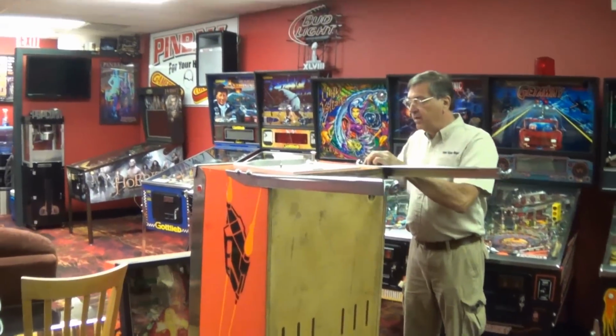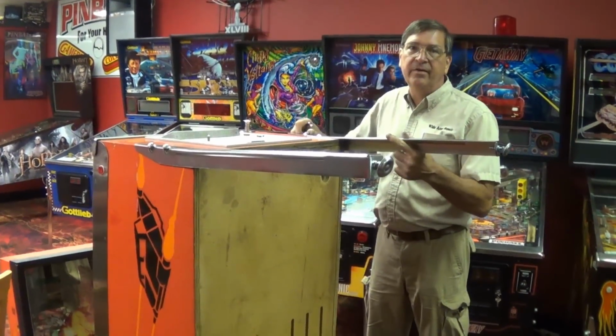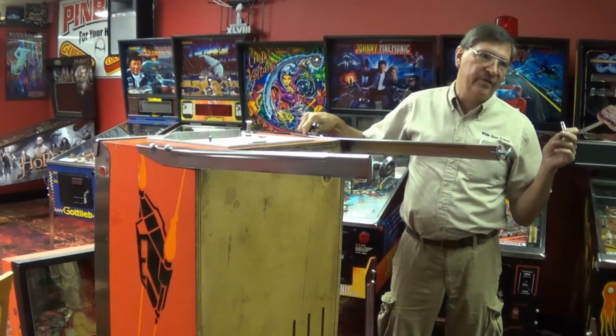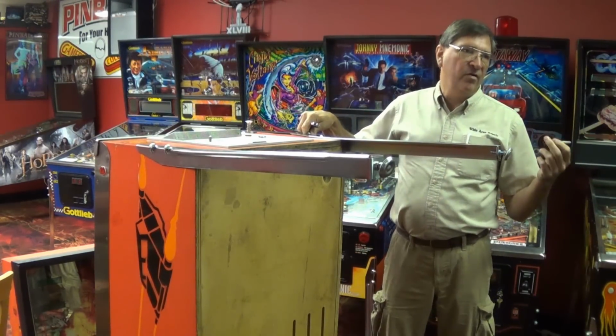And at this point, for you power tool guys, you'd be done already, which is fine. Do it, if you want to strip these bolts out. These, by the way, are grade 2 bolts, which is why you don't use electric or air tools on these.